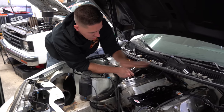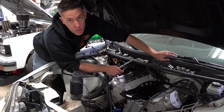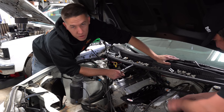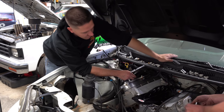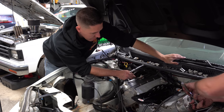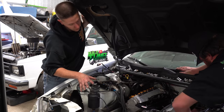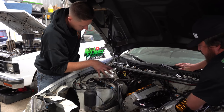Normally I would just grab it and pull it out, but I wanted to try to use this Motion lift plate - it's actually a Gen 5 one for the direct-injected motors, but I think enough of the bolts line up to use it. That sensor has got to go so it can slide back over it. Thanks to Carter leaving his socket at home, if we get the right socket I could probably pull it off in the car, slide that plate back, bolt it down and pull it out. A little bit of a roadblock, but we'll get past it.